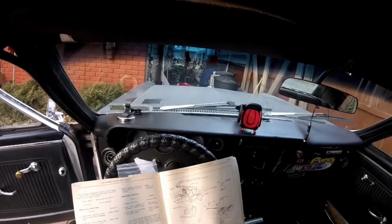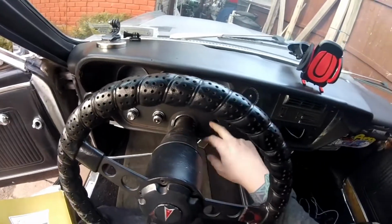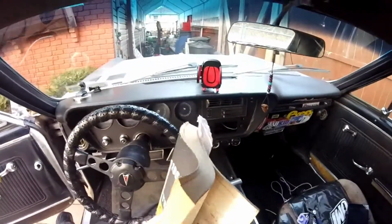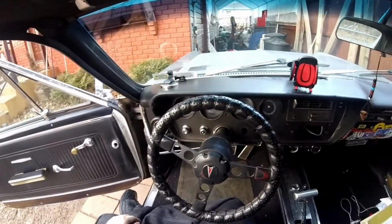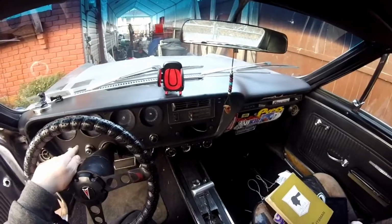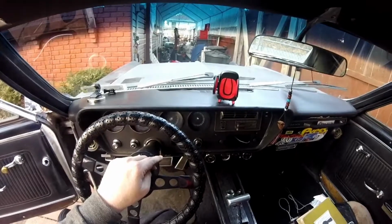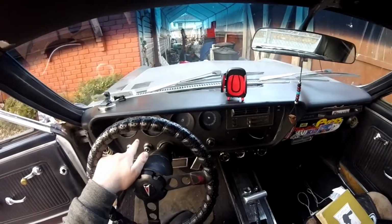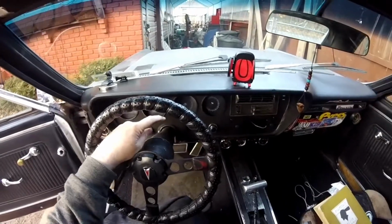Yeah, I got to figure out how I'm going to. Right now, I have oil pressure and temperature idiot lights going on when the fans kick in, one for each one, because the fans, modern fans, are using a ground switch, and these guys were using a positive switch. But I still need to get positive switch 12 to the fans. And I was out of options. I had nothing. I didn't want to run new. And I realized I had everything coiled up in the old harness inside the fender well, so I went out and I tested and found the oil and the temperature, ran those back up to the fans.